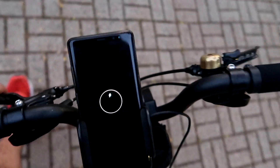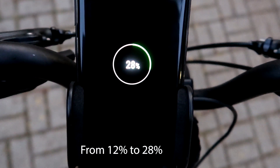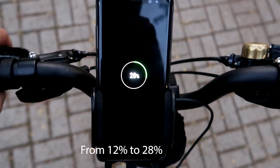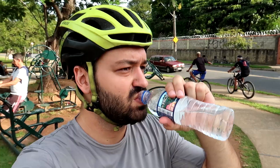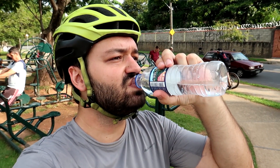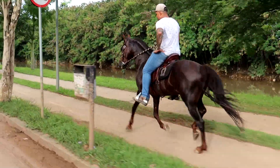After that one hour, I checked the phone again for the updated battery level, and it was 28%. Doing the math, it took me one hour, or around 18 km, to charge my battery by 16% — roughly 1% per kilometer. To be honest, I expected a bit more, but there's only so much we can do with a 3W dynamo hub without breaking the laws of physics.